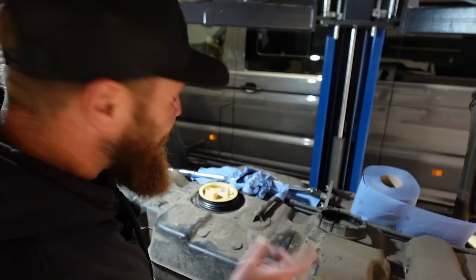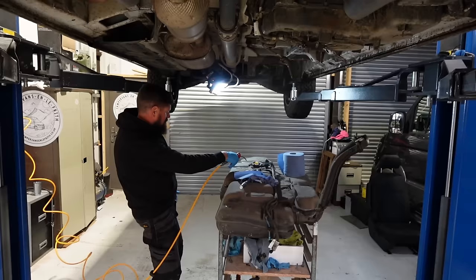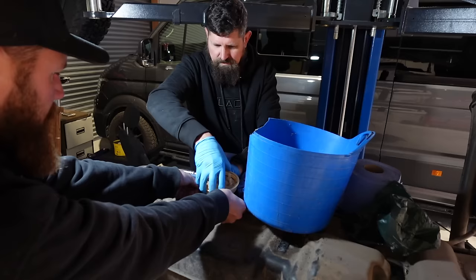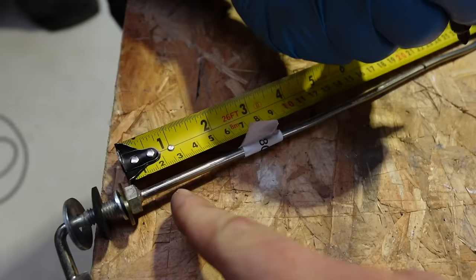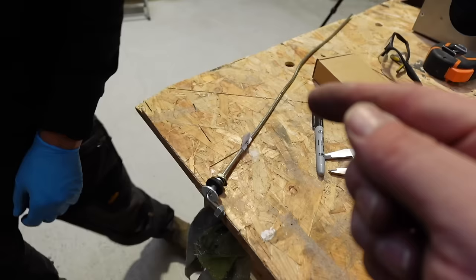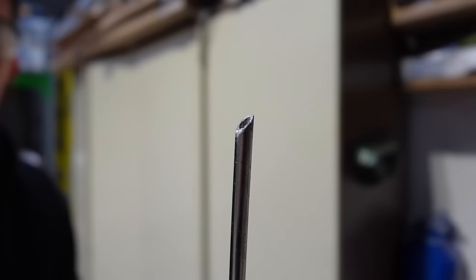The sender is out beautifully. Get a clean bucket to lift it into - you don't want any dirt particles or debris in your fuel whatsoever. Give everything a good blowout; anything loose needs to go. From the back of the nut, the standpipe itself is going to be 210mm - we'll cut that with a grinder with a sharp blade, deburr it, and cut it at a 45-degree angle to replicate the original.